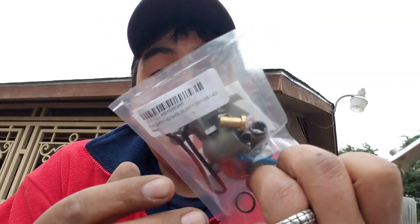This is from Amazon, so I don't know if it's a knockoff or if it's gonna leak or not, but it's gotta be better than what I had. It's supposed to create about... I think the regular fuel PSI is about 44-45 somewhere around there under load. This new blue spring system should pick it up to about 60 more or less, and that should help save your injectors from starving from fuel. I ran out of fuel a couple of times, so I might have already jacked it up.